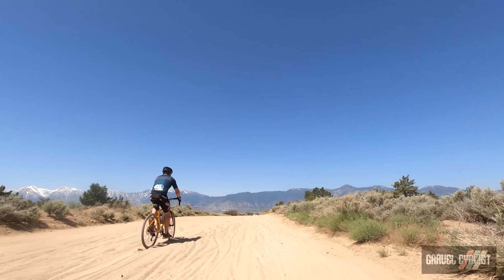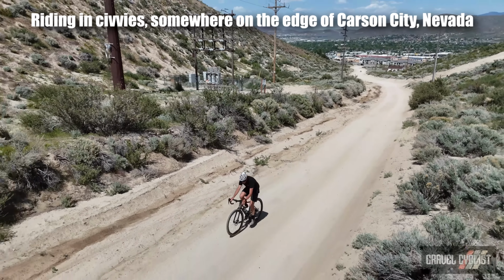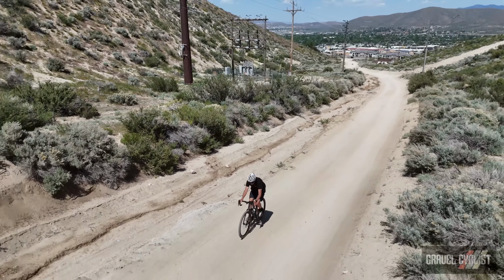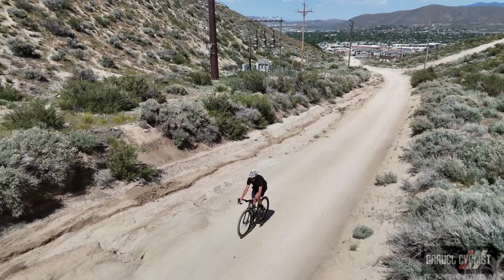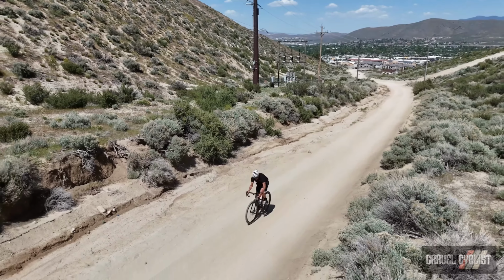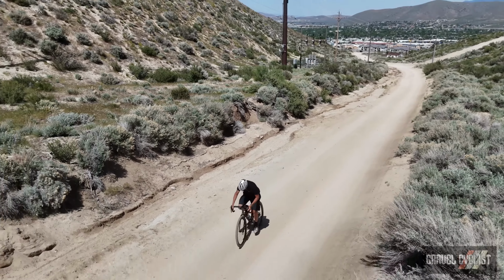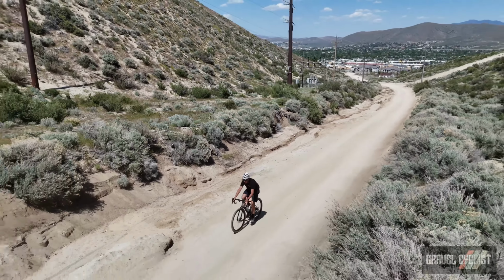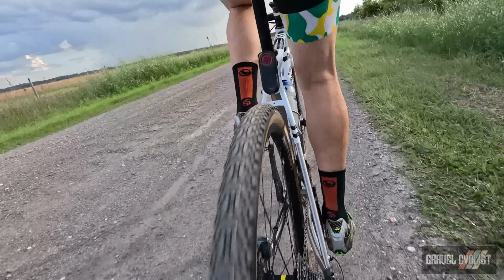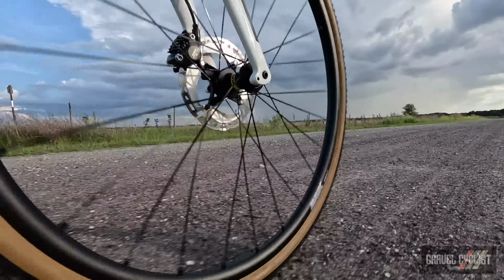Feeling wise, the X1 and X1R both ride harsher at the equivalent tyre pressure of the GKSK. I asked my mate Jeff Zell of Panaracer USA, boffin of boffins, aka super smart tyre bloke, about what was happening here. This all has to do with the Tough Tex protection in both variants of the X1. Simply put, Tough Tex isn't as pliable or flexible, or their ultra wanky word, supple, as the GKSK casing. Therefore, I had to adjust my already low tyre pressure to lower again for the X1 tyres.